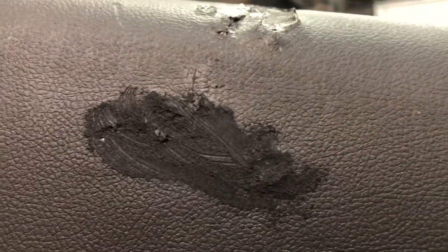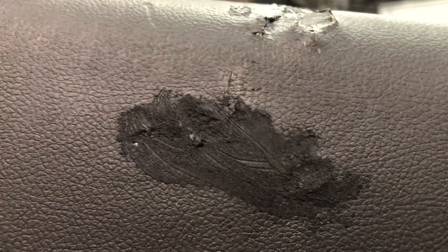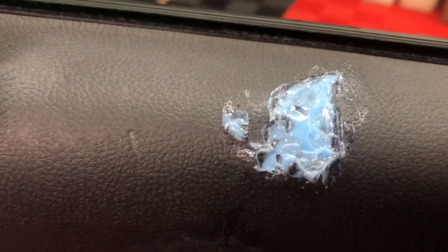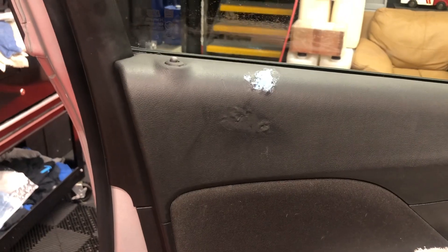We can see the effects now and we've got to get all that grained up. We should be back to quite a stable state, hopefully. We've applied a little bit of filler in the bottom one, so we need to do a little bit of sanding and then apply more filler. In the top one, we've used our grain copier compound which we're going to cure in a second to get some grain in this top area. Down on the side it's not so noticeable, but on top it's much more visible, so we're going to get some grain into that side pattern as well.